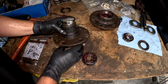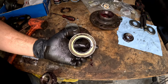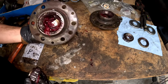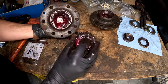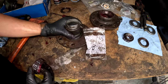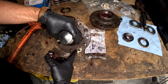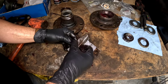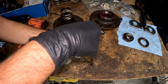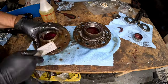The seals came out a lot better than expected — actually really easy. I think the seals are fine and I can probably reuse them. It's definitely worth taking them out and repacking the bearings anyway. Make sure you keep your bearings with their races — I labeled one 'B for beat to heck' since I damaged that hub. Keep them organized so you know which one goes where.